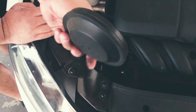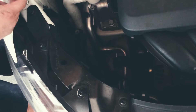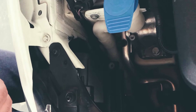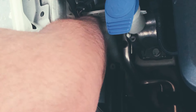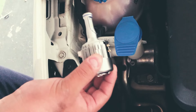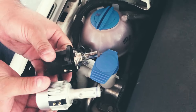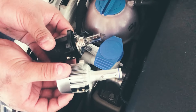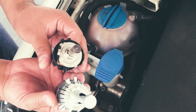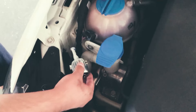There's going to be a cap right behind the actual housing before you get to the bulb, so it'll be right here. You just pull this out and then you'll have access to your bulb. It's just going to be a twist-on. You can see they have the same design — both the prongs are in the same direction and the locking keys are the same as well. Make sure you put the originals to the side; you want to keep them too.